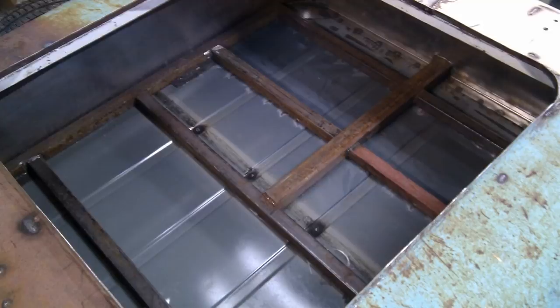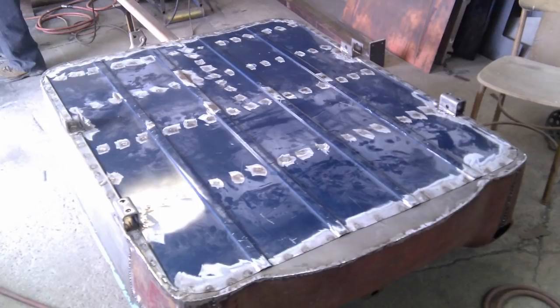The trailer has the frame inside of it. The reason we done this is because we wanted to put a plywood floor in the bottom so that any moisture or water that got inside the trailer would not sit on the floor itself — it would go underneath it into the steel frame, then run out through the little excess holes I had left in the back of the trailer. All I did then was weld it all up, spot weld it on, and seal it all up.